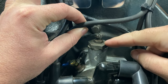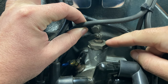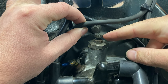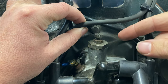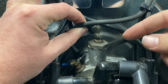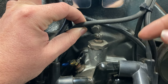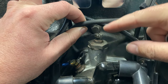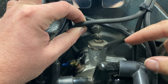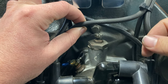If you do want to run the vacuum brake, this adjustment is done while the vehicle is under load. You undo the jam nut, run the bolt out with the engine under load until it starts to ping, then bring it back in. I can't imagine anyone being interested in riding on top of a flathead engine going down the road — so there's a bunch of back and forth. Ultimately you're trying to find that sweet spot between the spring overcoming the vacuum and the vacuum doing its job.